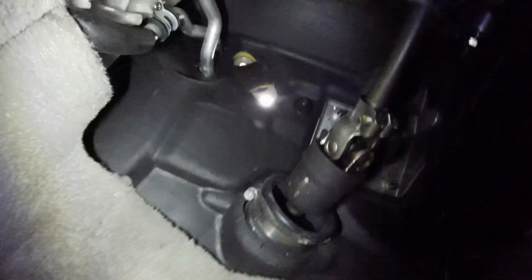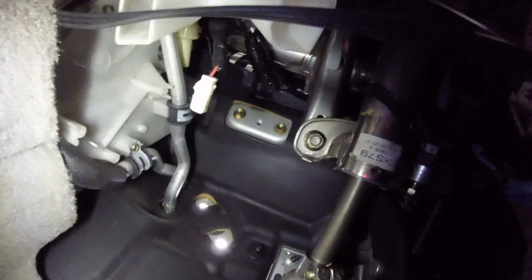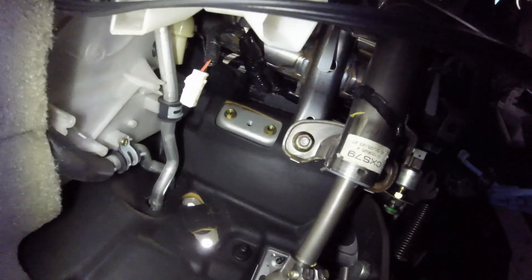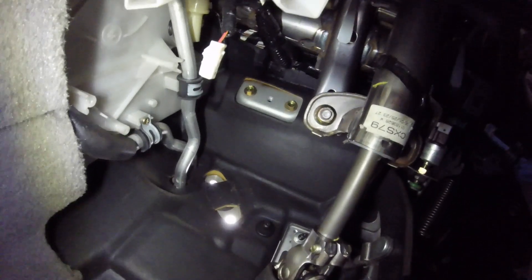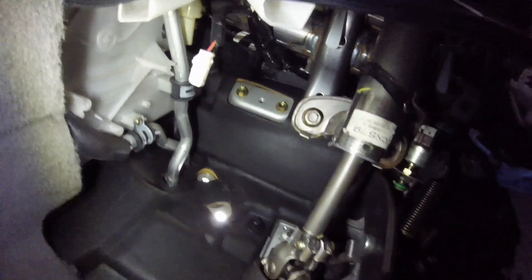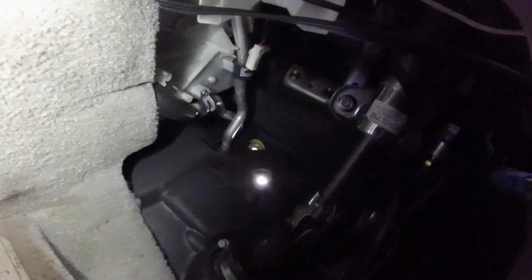Underneath, as you can see, there's a big automatic pedal. If we look up you can see the two holes for the master cylinder. Above that there are two gold-colored screws — those were for the foot handbrake. There's also a threaded hole in the middle — not sure if that'll fit the dowel. That brake pedal looks easy enough to either trim down or just change. First things first: remove that grommet and get the pedal up. Two hours later — the pedal's pretty much fixed in place.